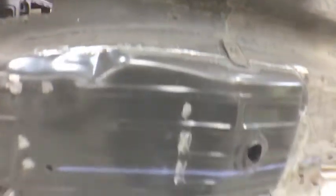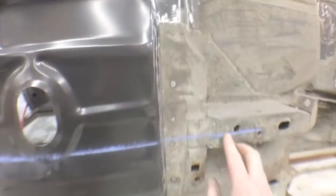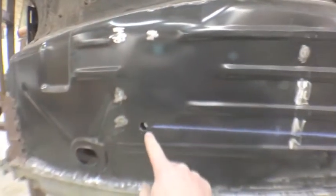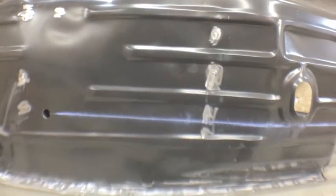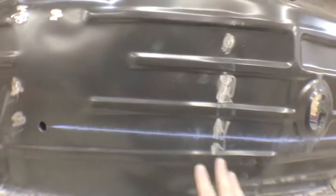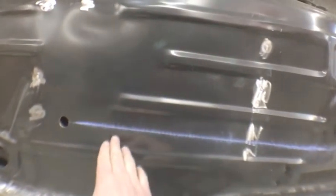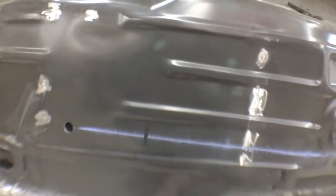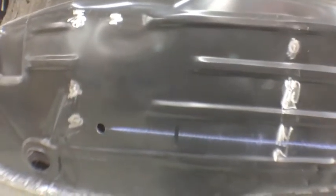You can see I haven't done the lower one yet, but here's my chalk line. This actually holds slightly off center of the subframe. I'll basically measure from the center of that blue chalk line to the outside edges of where I want to channel that back. The other tricky thing is on these subframe connectors — a lot of them that I've seen, they're not into the pan the full distance. They stop around back in here where they protrude back out of the pan so they can connect right to the subframe. I'm not doing a lowered subframe on this.